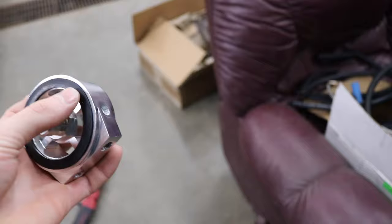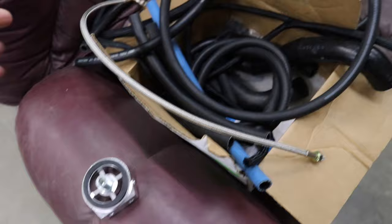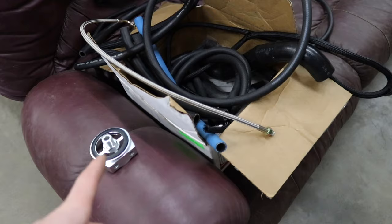I'm going to get Jack Spania to send us out one so that when this sandwich plate leaks — because I'm assuming it's going to — we can just install that quick. All of the threads in these three holes are 1/8 NPT thread, just so you guys know. And this oil feed line also has 1/8 NPT thread on the end. I threaded that into the sandwich plate by hand and when I went to thread it out it bound up — I literally had to run a tap through and clean up the threads on that and on the oil feed line. It seems like with the CX Racing kit I've had to clean up threads on about 90% of the parts.